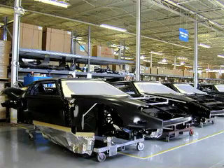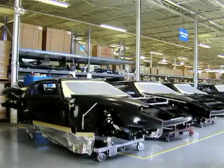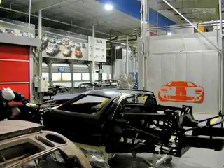After an inspection to search for any imperfections, the body is disassembled for masking. The body panel's black color comes from an electrocoating process. This involves charging the body panels with negative ions so that the positively charged paint will better adhere to them. The body is placed on a roller cart and washed with reverse osmosis high-pressure water before it is heat treated at 240 degrees.